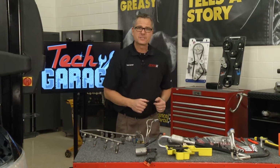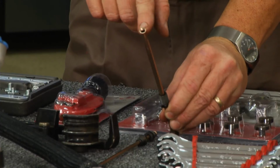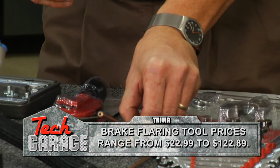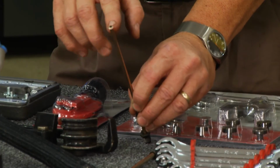Now we'll turn our attention to the brakes. Brake lines come in all shapes and sizes also. This one is a double flare. Now the double flare comes out and flares on itself, and this one here is called a bubble flare or an ISO flare. They're different, and where they go in are different, so you have to get the right lines.